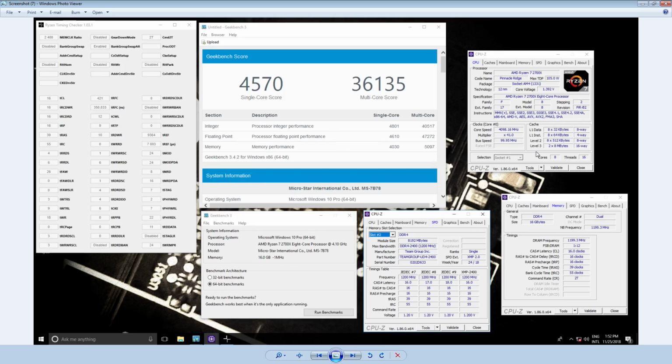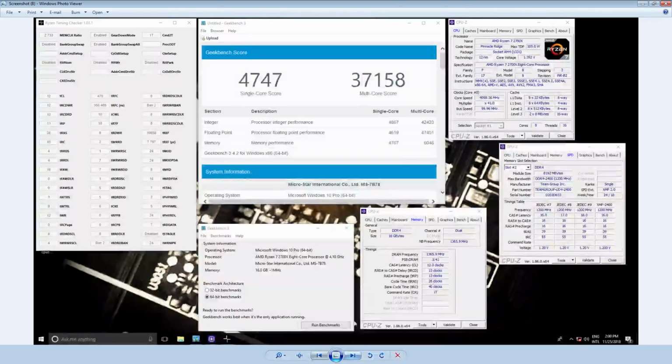So no surprises there, and it does boot. I've not had a problem with this kit working on any AMD motherboard I've tried so far. It does not overclock very well relative to good B-die and E-die, but it works, especially at stock settings. Compared to the Antec Series 3 stuff, if you're just looking at the frequency, sure, it's not amazing. If you're looking at the performance, then this is basically on par, as we're about to see.